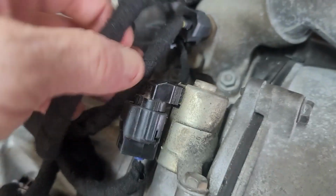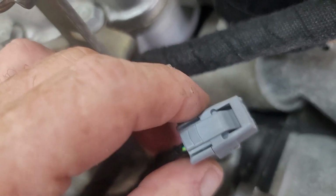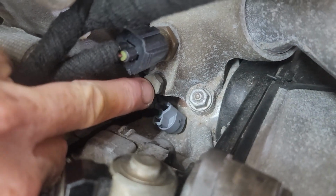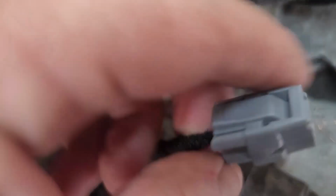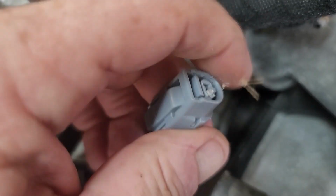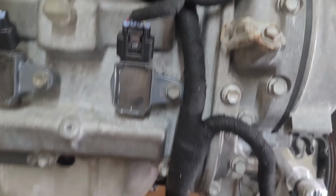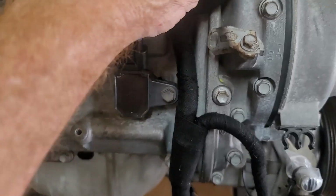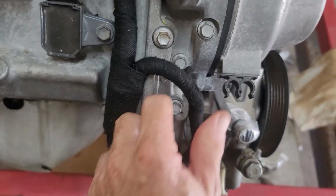Throttle, okay, and EFI water temp sensor. We've added in this one over here, which is a single probe for your dash temperature gauge. So just underneath the EFI sensor, you'll see there's a little stopper plug. You can screw that out and go and get yourself a Toyota sender unit, and then this will plug straight into that. Okay, and then it comes out of your client plug, so you've got no loose wires hanging off your engine harness.